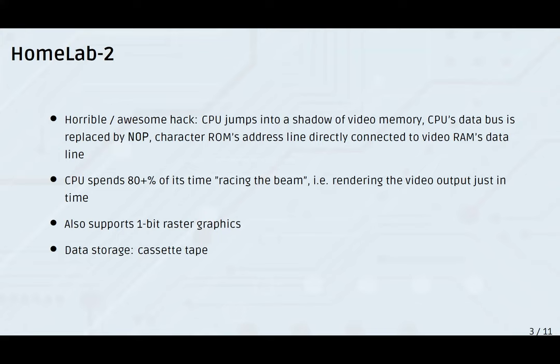So this way the CPU can go as fast as is possible for a CPU, because the fastest way you can scan some area of memory is to use the program counter instead of any other register. If you have any other register, then just loading the instruction that would increment your counter is already much slower. Whereas if you just execute a NOP, a side effect of executing anything is increasing the program counter. But the math still doesn't work out.